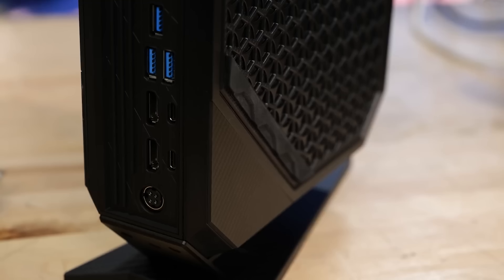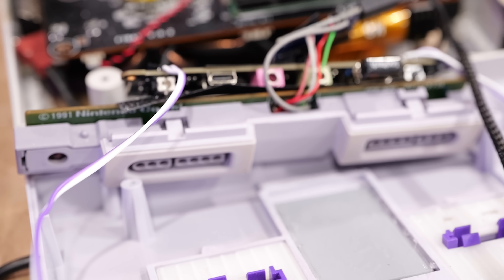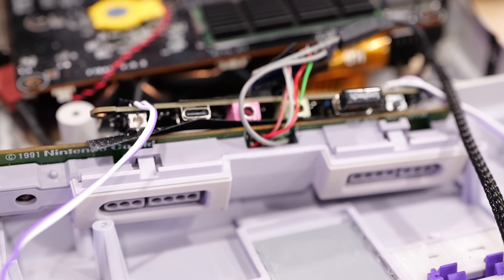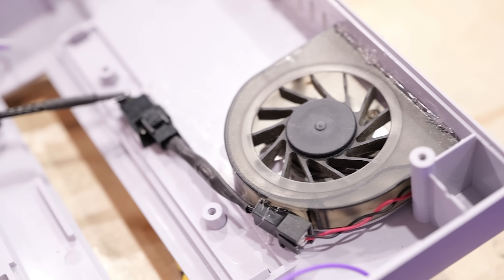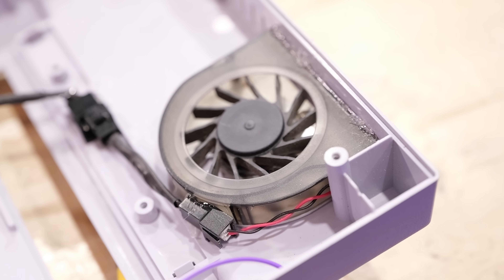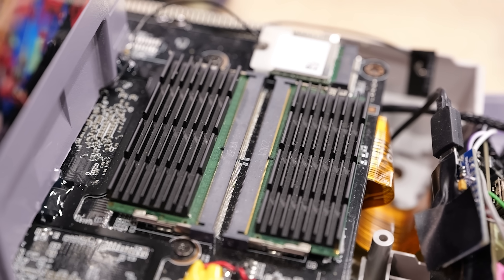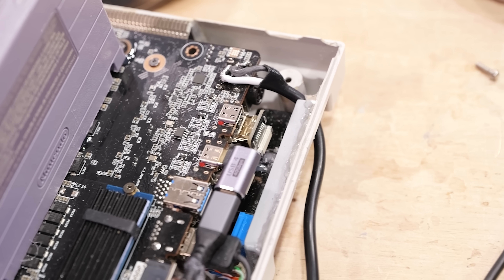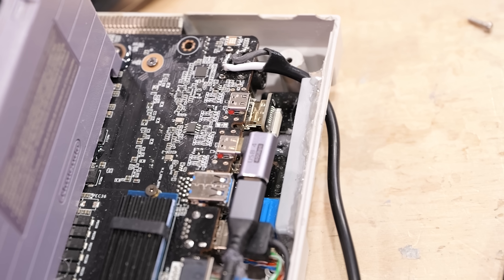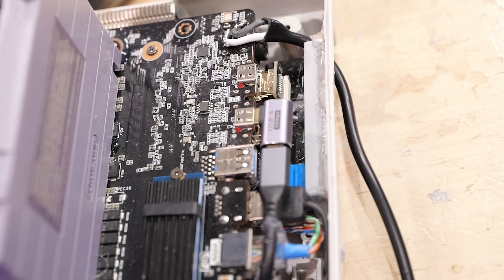You can check out the full review I did of the Minisforum machine on which this is based — it's just been repackaged into this with some different IO connectors. Hot glue on the motherboard definitely wouldn't have been my first choice, but it does have an integrated Logitech Unifying receiver. A small auxiliary cooling fan has been added, which is where most of the noise comes from. The DDR5 memory remains easily accessible, as does the M.2, and everything else is just port extensions — flexible flat cables for HDMI extensions, a USB 4 right-angle extension, and an ethernet extension from the back port.